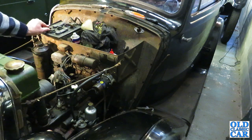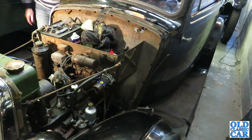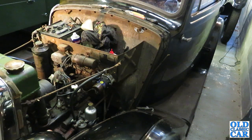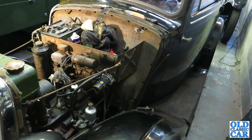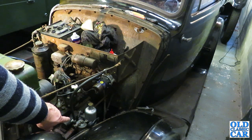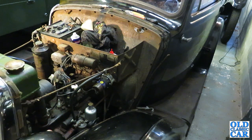Battery on. The pump's trellering away. Is it going to pull anything up? It's making a few different noises. Eventually you want to hear it slow right down and go do-do-do, and then it should be filling up the float chamber. Slowing down — that sounds encouraging. Blowing through the line probably helped. So I think we can go and have a go and see if it'll actually start now running on fuel it's got on board properly.